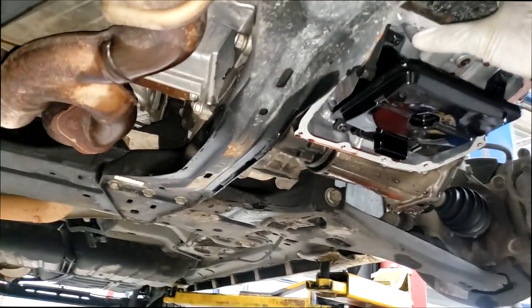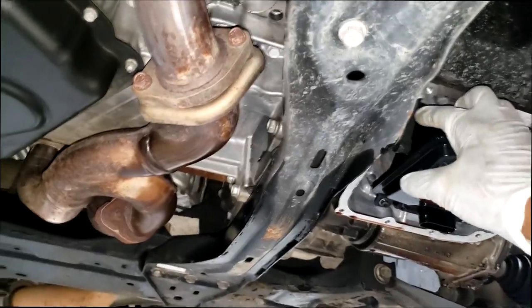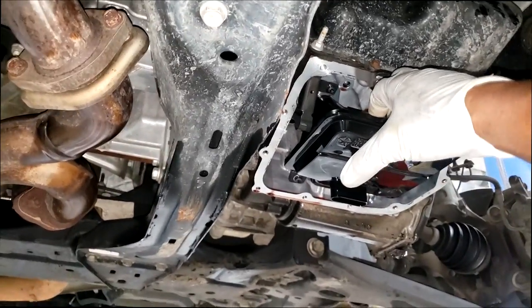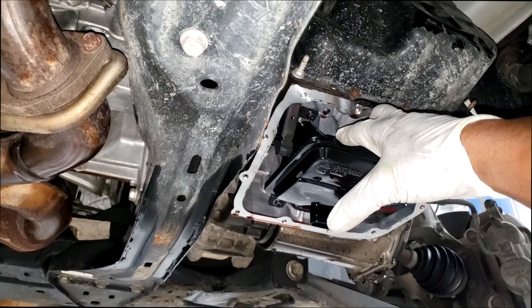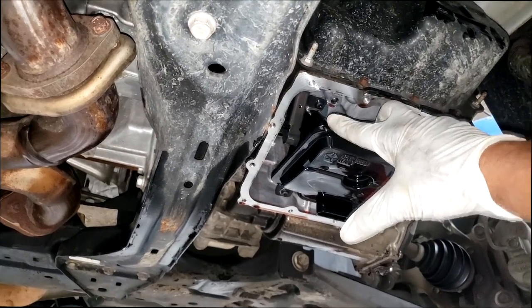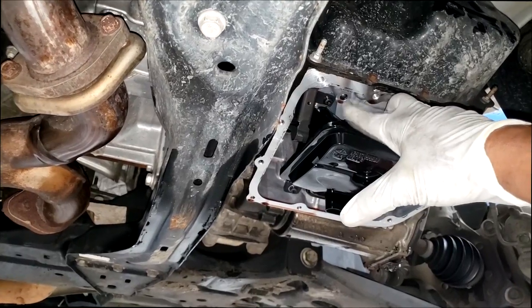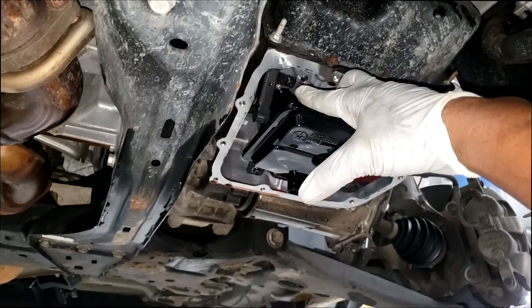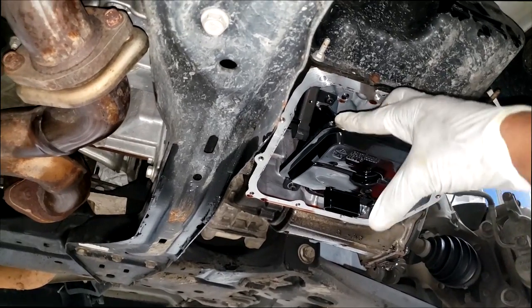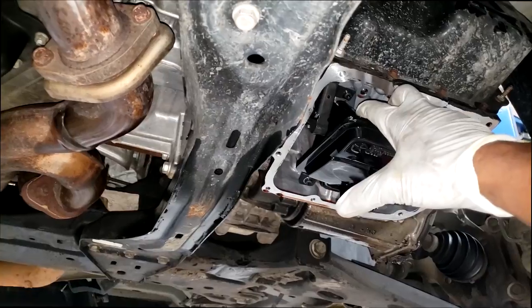While it's on my brain, let me go to the computer and show you the diagnostics surrounding that fault code. I can show you the proper name of that fault code, because it may show up on a generic scan tool as 'torque converter clutch lock-up' or something like that. Now on a 41TE — also known as the A604 — it's different. Some of the electronics change, so you have to read the manual and find out which car is equipped with what. But again, the only success I've ever had with this code is replacing the torque converter. Let me go to a quick break; when I get back we'll be on the computer and I'll show you what the diagnostic tree says.